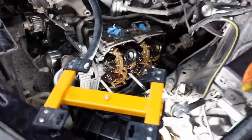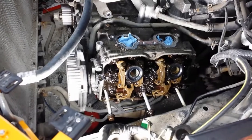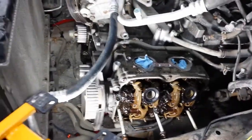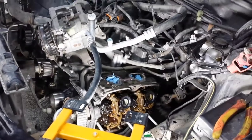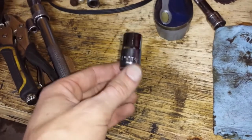The engine tilts to the side as needed. I heard the dual cam is a lot harder to do this way — better to pull the engine for that — but this was pretty easy. So yes, you can definitely do head gaskets in the car with a single overhead cam, no problem.